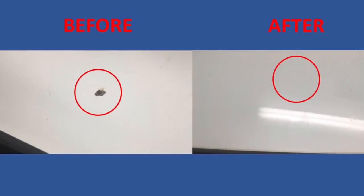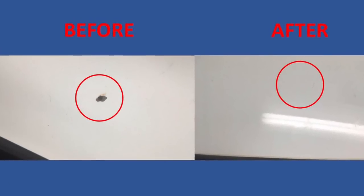Quick wrap-up summary: in the end I'm pretty happy with the result. Having never done this before, I think it turned out pretty well. From a distance you can't even see there was a rock chip. I'll put up a side-by-side comparison so you can see the before and after. Some takeaways: if I was doing this again, I wouldn't sand so far around the rock chip area, and I wouldn't gloss all those sanded areas — I think rubbing it out with the rubbing compound would have been enough. Anyway, for less than 30 bucks, still pretty happy. If you like this video, go ahead and click like and subscribe to my YouTube channel, DIY Jeff, for more DIY projects.